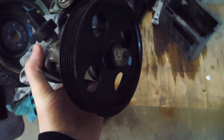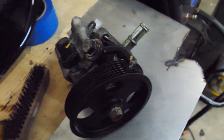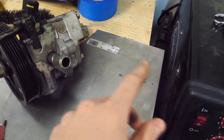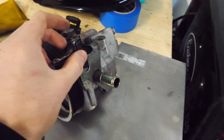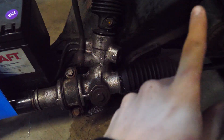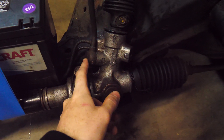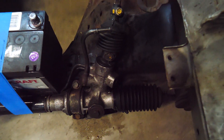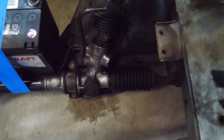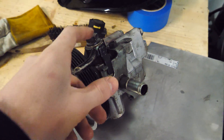This right here is our power steering pump — nice and light, nice and simple. It's got two fittings: this is the pressurized feed fitting, it's some sort of banjo bolt. Then we have a non-pressurized hose going from the reservoir into the pump — a soft rubber hose that feeds into the pump — and then there's a pressurized hose that goes into the rack. That pressurized line comes into the rack right here, and then there is a drain line right here which goes back up to the reservoir. I think I can reuse this stock fitting.